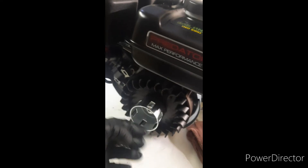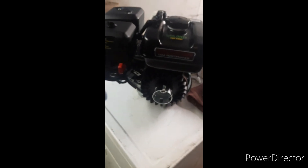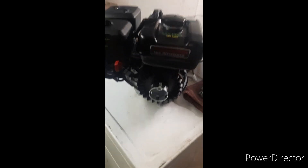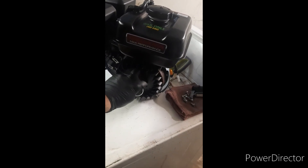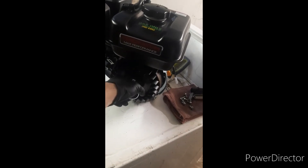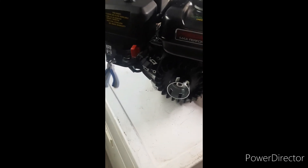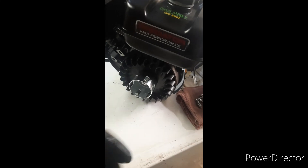Now I'm ready to do the coil, then the cover and the pull start, and then I'm going to crack the back side of the case open and clean out the shavings from inside the motor, remove the low oil sensor, and I always recheck the rod bolt torque on these. Since we're going to disable the governor and run at high RPMs, I've seen the rod bolt back out from the stock rod and blow it, so I always re-torque them.